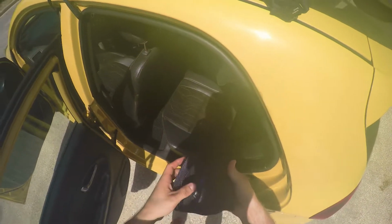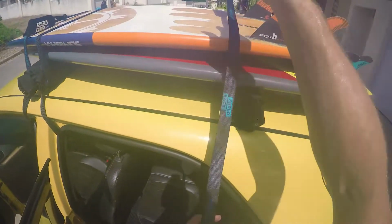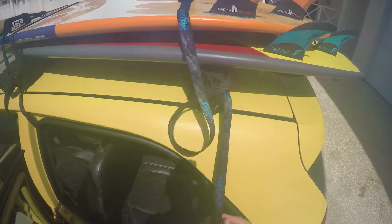Use another set of straps to lash everything together similarly on the second rack. Again, make sure to use the lashes of the racks wisely. If needed, you may also use the trunk of your vehicle to secure the rear rack. This can be especially helpful with 3-door cars.